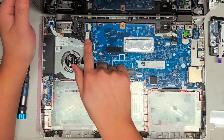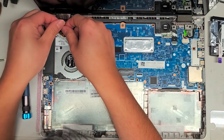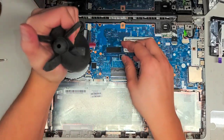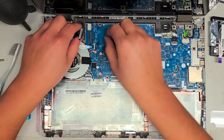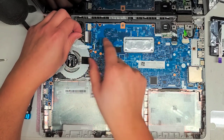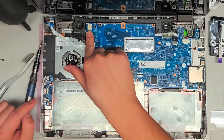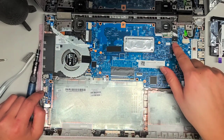The tab is on the inside. I'm just going to check and make sure this cable is aligned and make sure it looks clean. If you're going to remove this connector, you do want to press and hold the power button just to drain any power. I'm just wiping off the pins. A lot of people get annoyed at me for wiping it off that way, but I've had several computers that I've fixed that way.